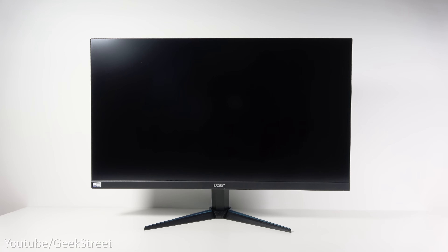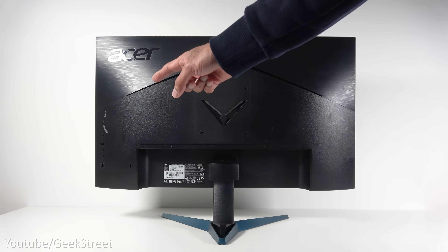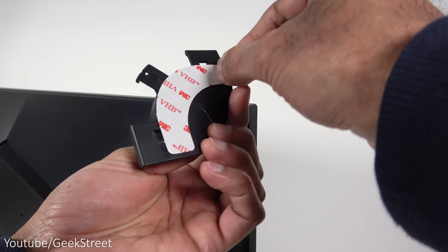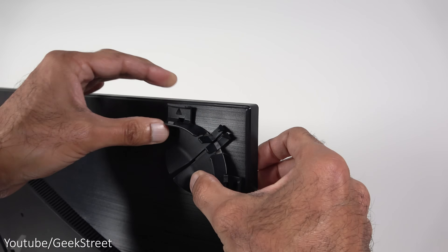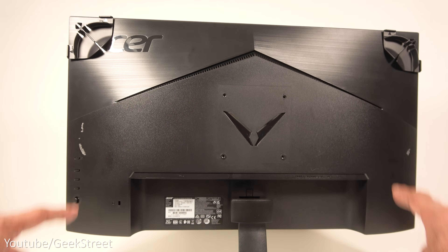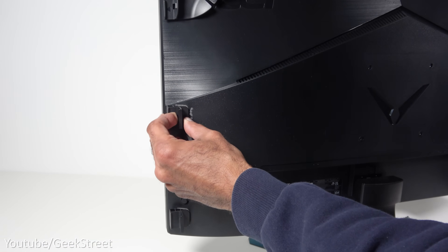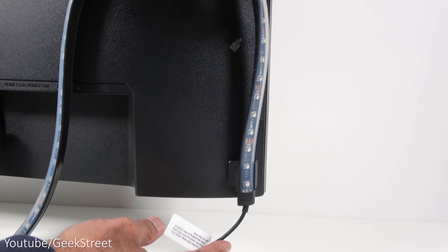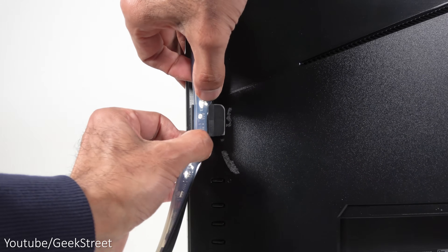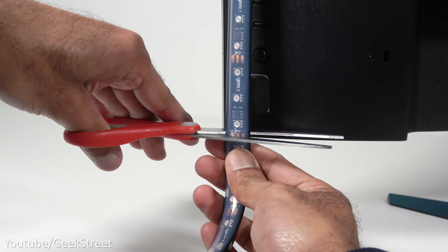I'll be installing the LED strip kit on this 28 inch gaming monitor. Looking at the monitor from the back, the LED strip doesn't cover the whole area — it just covers a U shape. To install the LED mounts, there's a sticky 3M sticker on the back. Peel that off and stick it towards a corner, then do the same on the other side. We can now install the straight mounts — two at the top and two on either side. We can then attach the LED strip, which just clips into position. The end piece can be cut off where it conveniently comes in at the bottom end of the monitor.